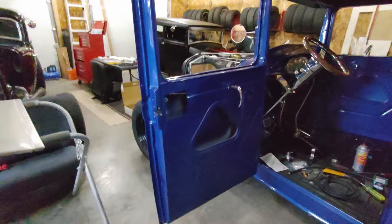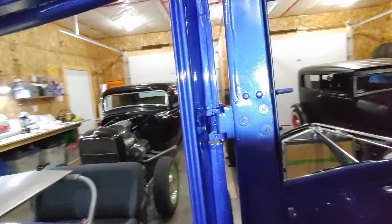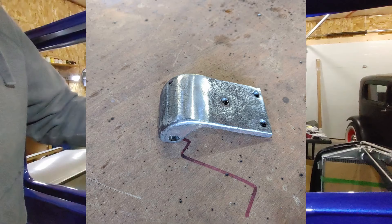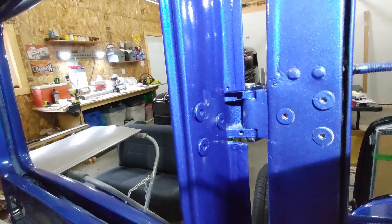The very first thing I actually had to start with was reconstructing the hinges. The hinges were pretty much shot — the holes were oversized. So I had to take the hinges out, weld up all of the holes, re-drill and tap them. Even the pins themselves had been bored out pretty badly, so I had to weld those up and re-drill those. I currently have some oversized GM hinge pins in them. So the first step was to get the hinges fixed.